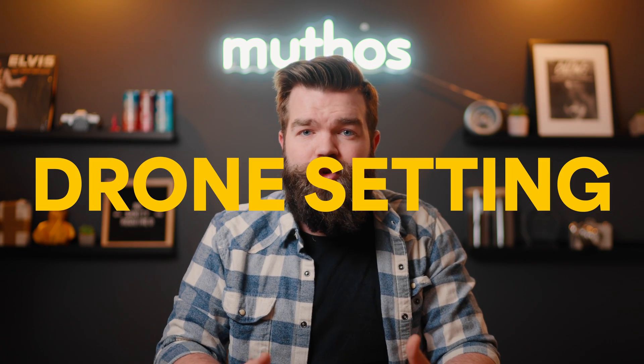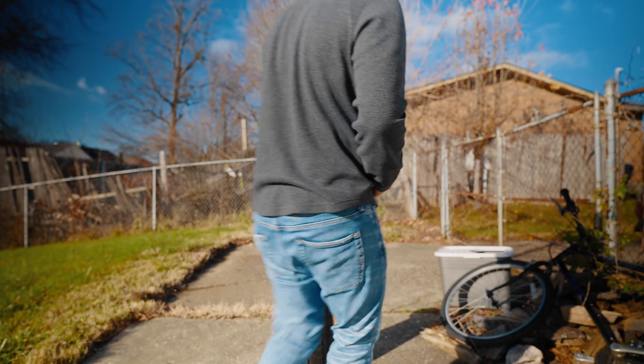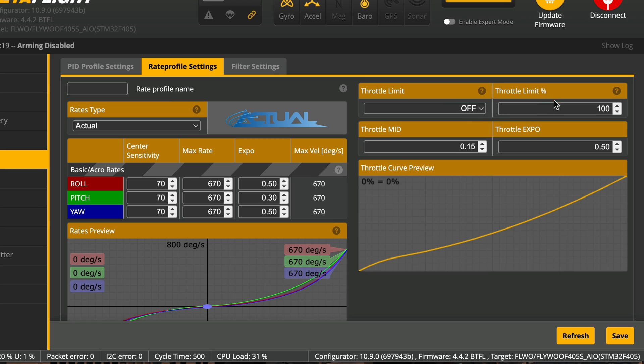The other thing that you want to do is to tune your drone in Betaflight. I am no Betaflight expert — this is just how I have found to tune my drone. Betaflight has way more tools than what I use and can be super intimidating, but this should help you get where you need to go. The process I go through with a brand new drone is hooking everything up, getting it ready to fly, then taking it outside over grass to test how the drone feels. I look at my rates and where the throttle on my controller is when I reach the hover point. After that first test flight, I take my drone back into Betaflight and set my throttle so that my hover point is exactly at 50% on my controller. This can take a few tries to get right, but then I set my throttle expo based on how much movement I want in my sticks before the throttle kicks in, so I can make fine adjustments whenever I fly.